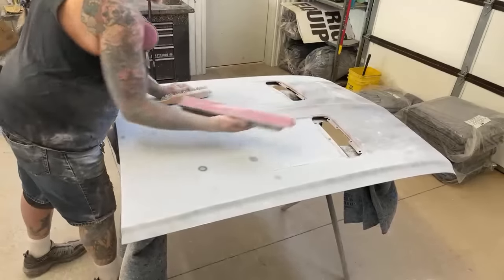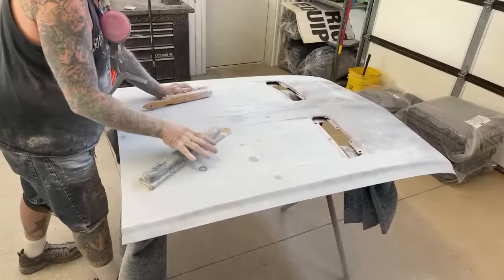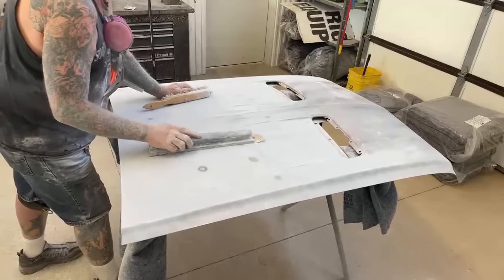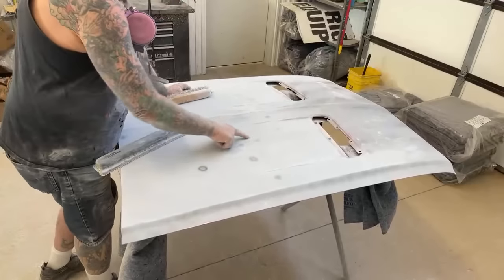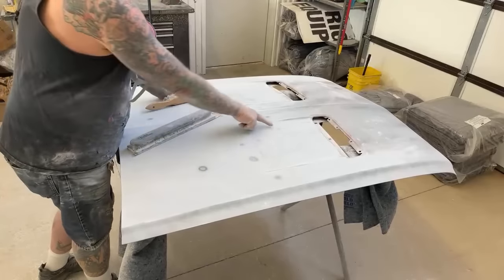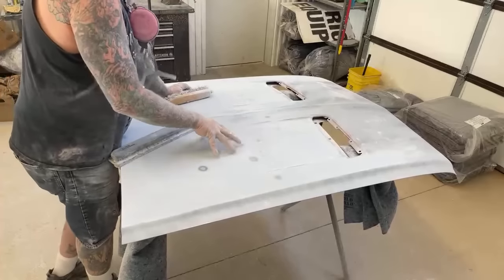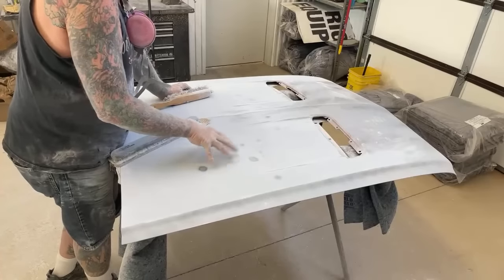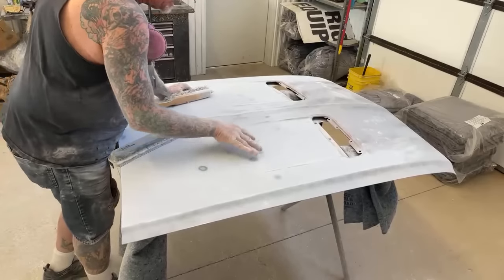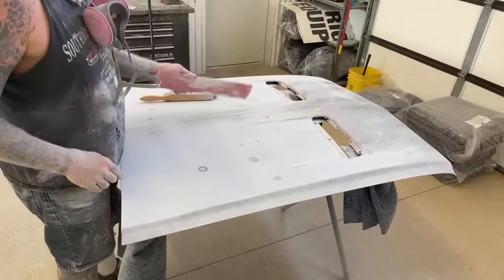As I'm block sanding I'm using my 180. When you're using a good block you can literally feel a situation going on on your panel - but you've got to have a high-tech block. So I'm over here sanding and all of a sudden I start seeing little imperfections I can't get out. You can see that I really sanded it - this is bare metal right here, here's another spot getting ready to be bare metal. I tried to let the 2K high-tech filler primer do the job, but when I rub my hand on it I noticed - no, it ain't going to work.